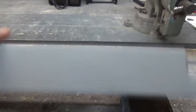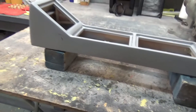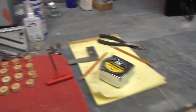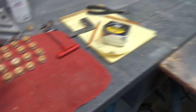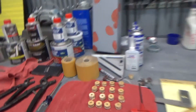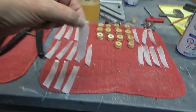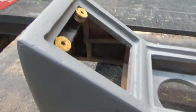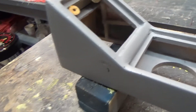We're gluing in the wooden nut plates and adding mat with them — two and a half ounce fiberglass cloth. It disappears in the resin, and then we'll bring it around to attach it and give it a little more rigid structure. We have a total of 16 of these — four times four, sixteen. I really should get in and start dinner. When I get more I'll bring you guys back.